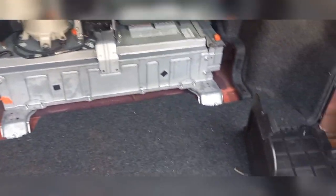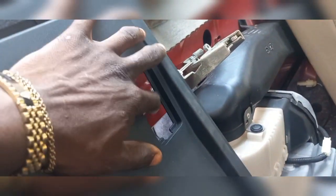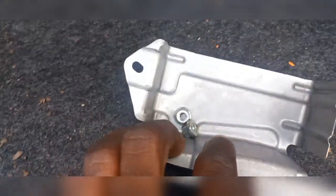I'll carry you guys along on how I actually fix the fault. I had to drop the seat from here. When I drop this one here, I pulled on this small lever here to drop the other seats. Then I took out my negative terminal. After taking out the negative terminal, I took off this shield that was being held in place by just two nuts. Then I took out the service plug. I'll be using the service plug here — look at this notch here — you insert it into this place and twist it towards this direction and this guy is going to come out.